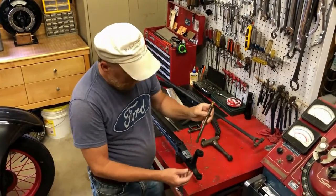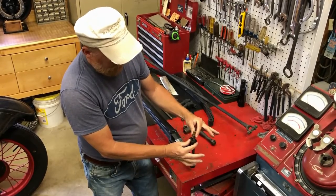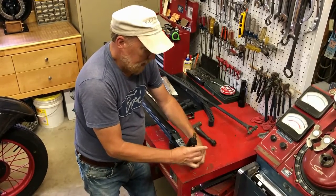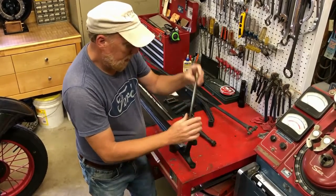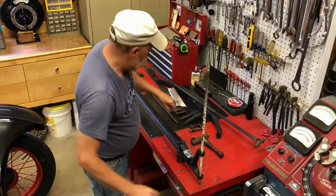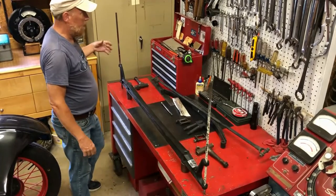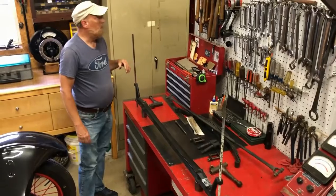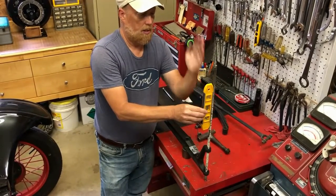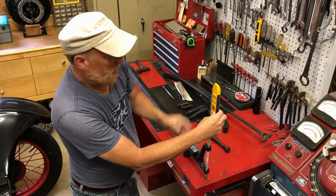This is a kingpin — it holds the spindle on. You're going to want to check and make sure that these holes are not worn out. There shouldn't be very much slop here at all. You want to make sure that this threads into the bottom and the threads are good. This one's good. I've already checked this axle out and I know it's good — everything fits. We're going to do a little test to check and see if it's bent or not. You need a dial indicator or a degree indicator; I'll use a level. We're going to check it to see if it's bent this way or this way. This one's good and straight. So this axle is good.